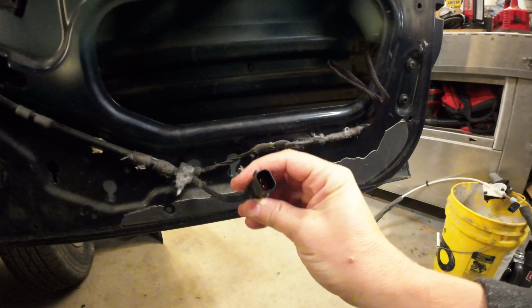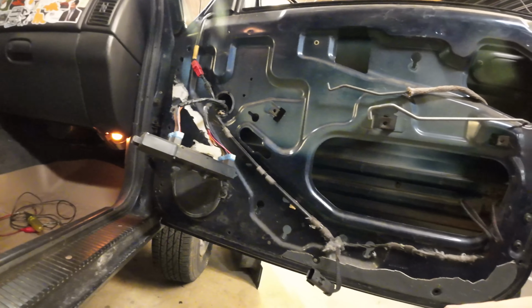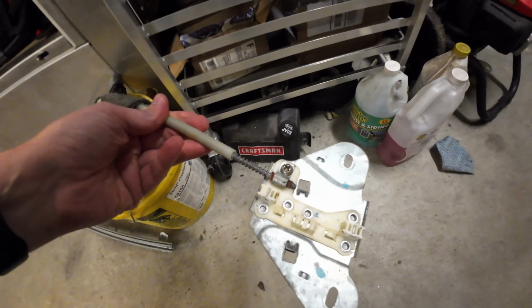I took it all apart. I tested the wire, and the wire will go down but not up. So the switch in here is broken, and actually it's broken I think in the driver's door because I was able to jiggle it and get it to go up. So wiring problem probably in the door over there. I'm going there next, but the idea here is because this was all broken, we can actually see this was snapped off. They definitely just did whatever they could to get it up.